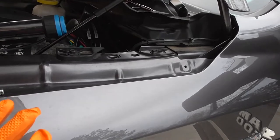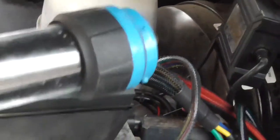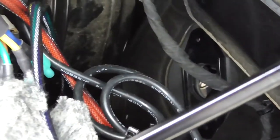It doesn't look like I damaged anything. So instead, the clutch block-off hole right here — I already had a small half-inch hole drilled to get my AUX switch wires through. I went and took a Dremel and Dremeled the entire circle out. In hindsight that is honestly too much — I can fit a zero-gauge wire through that. Pull this out; there's two 15mm bolts on the back side. Pull it out and drill a hole big enough for your amp wire to go through, and use that.